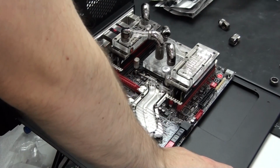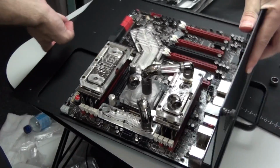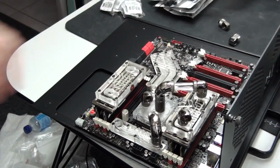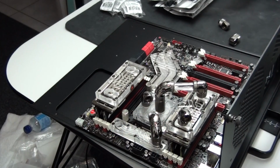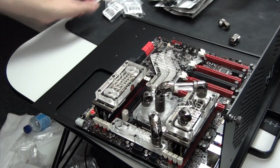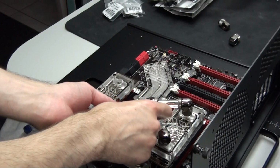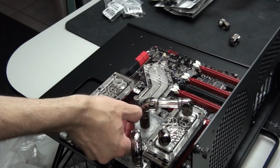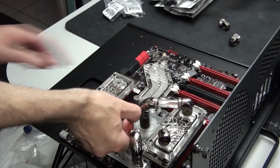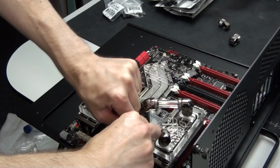So when it comes to the lengths, there are a lot of different Crystal Link fittings. Now, the Crystal Link fittings themselves are actually designed for multiple GPU water cooling configurations. So they come in different PCIe slot widths. They come in 2 slot, 3 slot, 4 slot, and 5 slot. And each set actually has 3 different sized Crystal Link fittings. And I think the actual difference between all of the lengths is 5 millimeters. So there are a lot of different sizes to choose from, pretty much a Crystal Link fitting for everything.